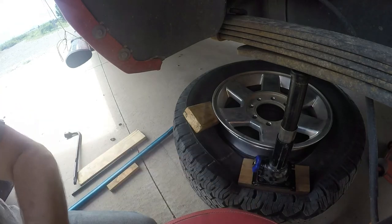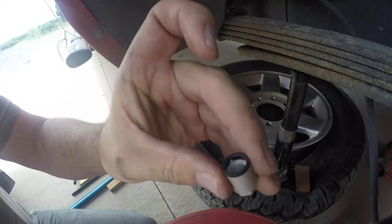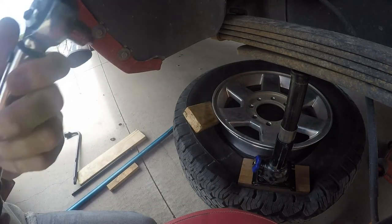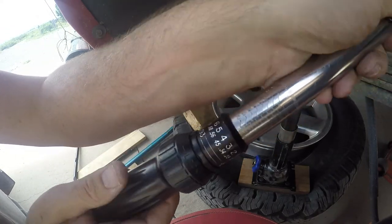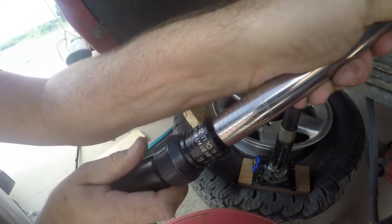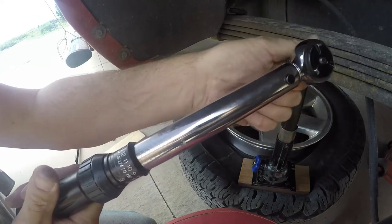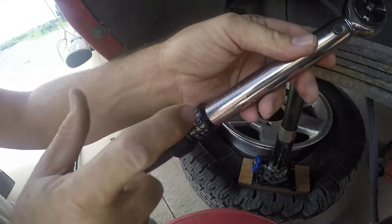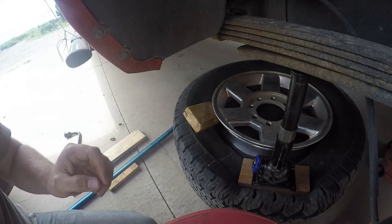It's 11 millimeter, fits nicely, so we'll use that. This is a micro torque wrench — the lowest setting is 25 inch-pounds. We're going to roll it to 25 inch-pounds at zero, then roll it back five. This is at its limit of being able to torque, so it's probably not going to be very accurate. Your best accuracy is in the middle of your range, but this will hopefully keep me from breaking it off.